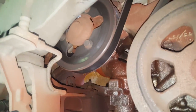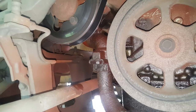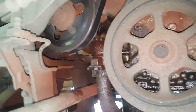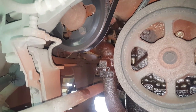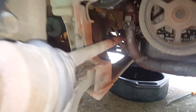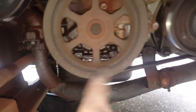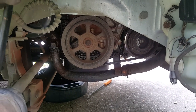With that piece out of the way, you can see where the failure comes — it's this water pump right here. The water pump has been dripping — got a pretty good puddle right there. Things like this, when they don't get caught in time, it would have just been a simple water pump replacement — maybe not simple, but definitely a lot easier than replacing an engine. So you have to catch things before they happen. With this cover in here, you can't really see where the problem is a lot of times. The particular fender piece was torn up anyway, so it wasn't doing a whole lot of good.